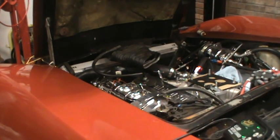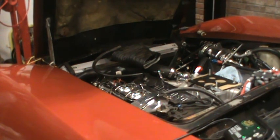So I checked with just the turn signal on, and the turn signal is lighting up the top filament. Now that could be one of two things. Either I've got the bulb in there wrong and it's not making a good contact with the ground because of that, in other words rotated 180 degrees, that would explain everything. Or the ground isn't good and it's going through the other filaments, like I explained before I started changing the wiring.